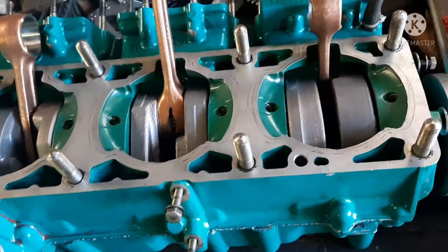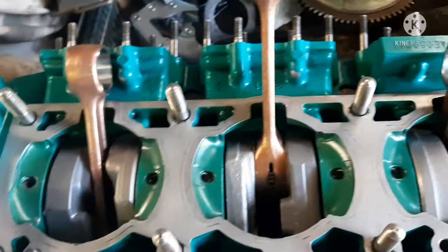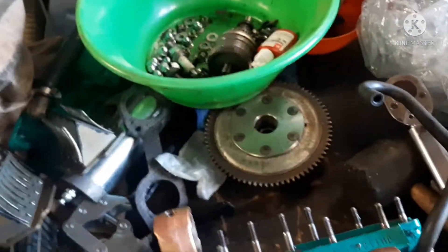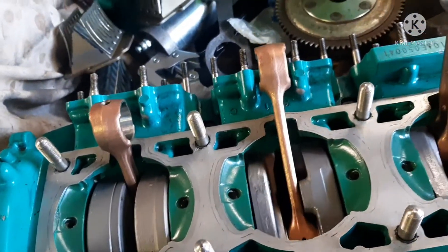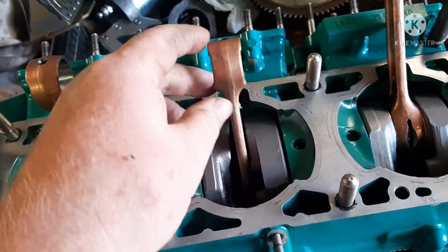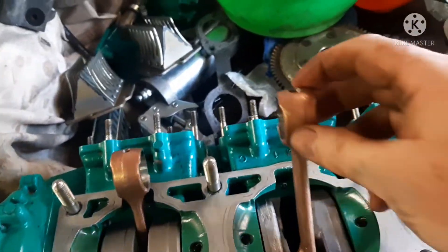This is the hardest part of the build coming up. Because what you've basically got to do — if you don't have an extra person to help you — since it's a single triple cylinder, meaning one cylinder with three holes, you're basically doing a balancing act. You're holding this thing up, holding the rings, and trying to seat it. How I did it last time was to get one end in the furthest up position like this.